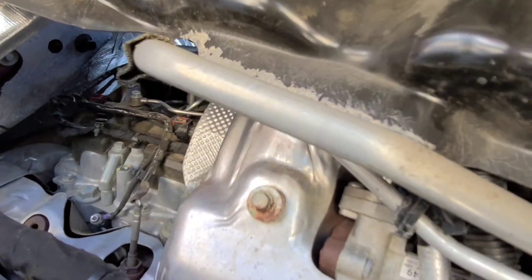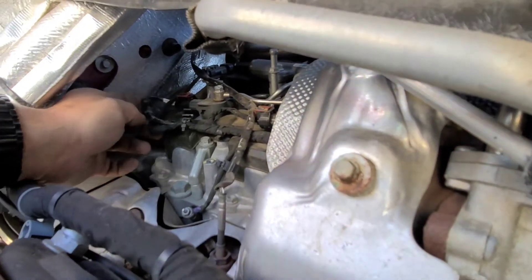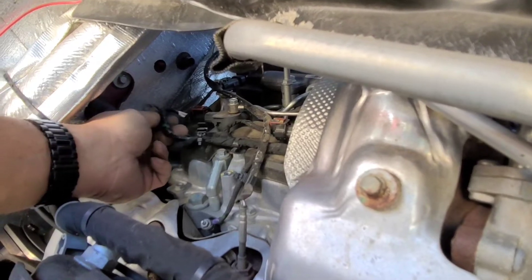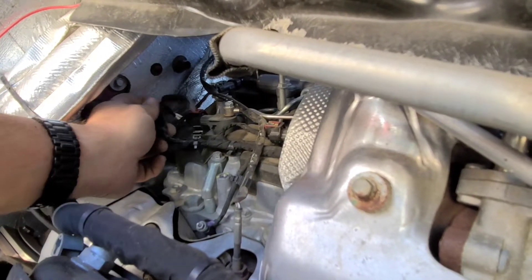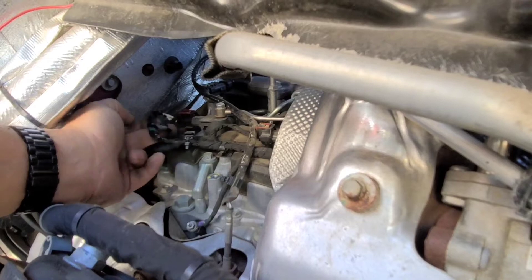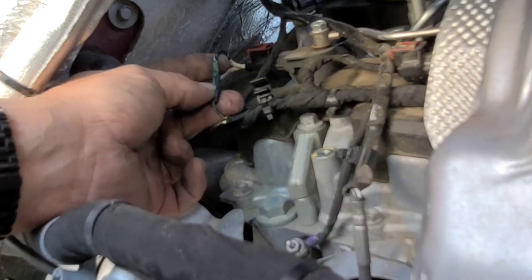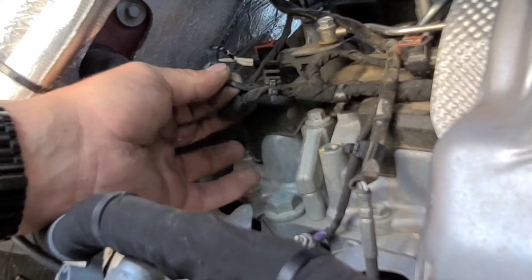When it comes out, this is the number 7 connector right here. This is where they put it together — I was really hoping that it had come apart right here, but it looks like so far it's still intact because it has been changed before, three months ago. That's why I'm hoping it's the connector and not the actual injector itself. It's saying circuit open, so that makes me feel like we're on the right track with the connector. I got it all unwrapped — I was highly hoping this butt connector had come apart, but that doesn't look to be the case. I'm feeling the wires down there to see if they feel brittle; I don't really feel anything feeling brittle.